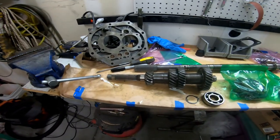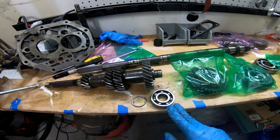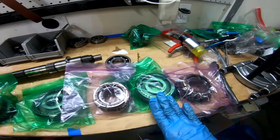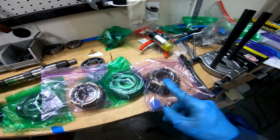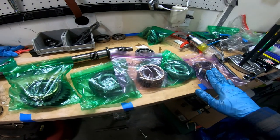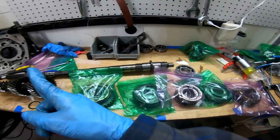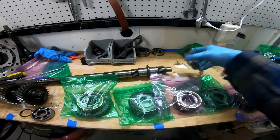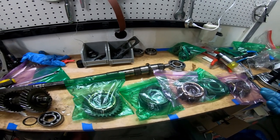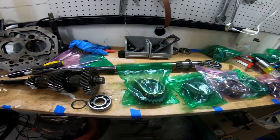Let's clean up the workspace and take a look at what we've got. From the countershaft, I have the bearing removed. From the main shaft, I removed: first gear, second and first gear synchro hub, second gear, third gear, third and fourth gear synchro hub, and fourth gear which is still sitting on the input shaft — along with the main bearing. Now that it's fully disassembled, I'll take a look at all the parts and then put it back together. I don't see anything wildly bad. Thank you for watching.